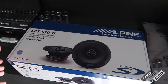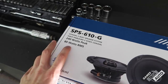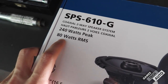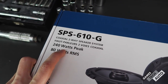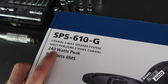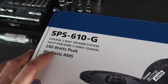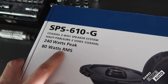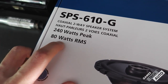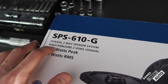So that's the speakers there — Type S, 80 watts RMS. I'm going to give you some massive advice when buying speakers. The peak power — please do not look at that, because that is meaningless. One sound system can have 400, another can have 200, and the one that's 200 might still be better. The only number you should look at is watts RMS — that's what you can consistently keep powering. That is the important number. Peak power is just a marketing scheme.